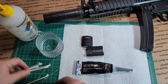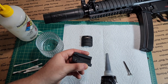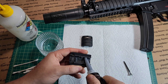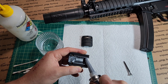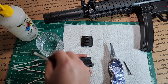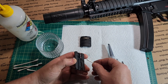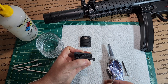Once that's pretty clean, open up your gasket maker — you can overdo it and you'll be fine. We're going to use a q-tip to smooth it out, so I'm just going to squeeze a bead just like that. To smooth it out you could use your finger, but I find a q-tip works best — just lightly dampen it in a cup with isopropanol, dry it off, and then use the top rib as a guide to help smooth it out. Just drag it along that rib and you've got a nice smooth bead.